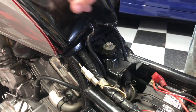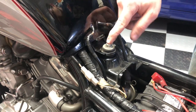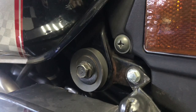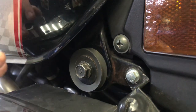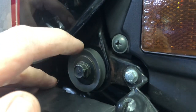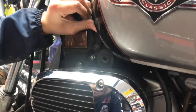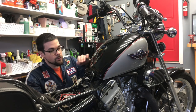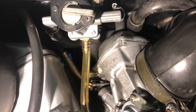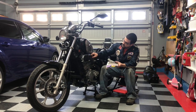Don't tighten this down too much just yet. Let's do the side mounting bolts first — that way if we need to shimmy around the tank a little bit, we can. After we get those side bolts in, we'll come back and tighten this up. Your side mounting bolts should be 12 millimeters. Don't tighten it down too tight yet; we're going to do the left side of the Vulcan next. Here's a close-up of that mounting tab attached to the fuel tank — metal on metal connected to the motorcycle. Make sure you have your rubber damper and your 12mm bolt. Now with the fuel tank mounted at the three points, go ahead and tighten down the three bolts. With the fuel tank securely mounted, I was able to use more force to get the vent line fully on the nipple of the petcock. Finally, before you forget, turn the petcock back on — on is in the down position.